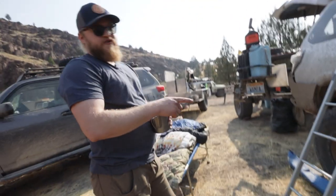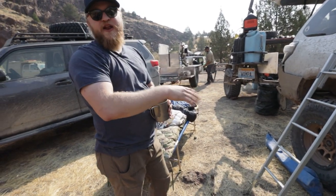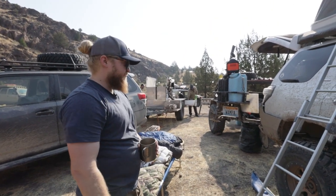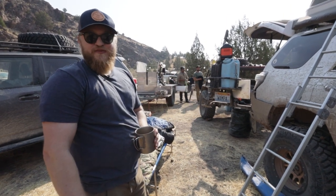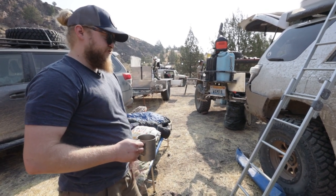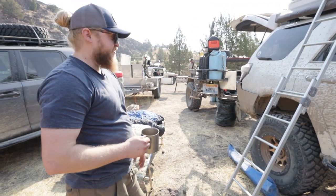I do have a double cardan rear drive shaft on this as well. Because of the lift height. Again, I've had multiple coils on this, and I was running a Dobinson's progressive spring rate coil for a while that was quite tall when it wasn't loaded. I've had a lot of vehicles in the past and I just didn't want to deal with driveline vibrations. South Bay Driveline in San Jose, I've used them for years too. They're fantastic. But Tom Woods or any of the other big driveline manufacturers online, you send them measurements and they'll get it out to you. Most of your local drive shaft shops are a day turnaround and do awesome work, and it's not very expensive to have done, but it's definitely worth it.